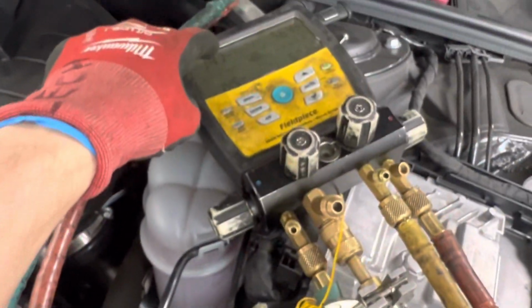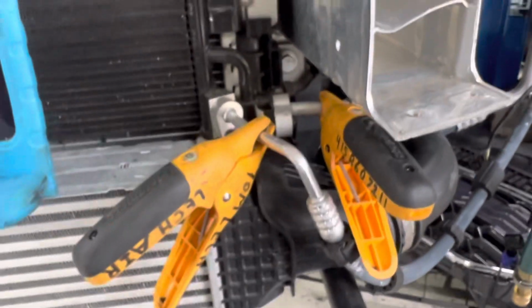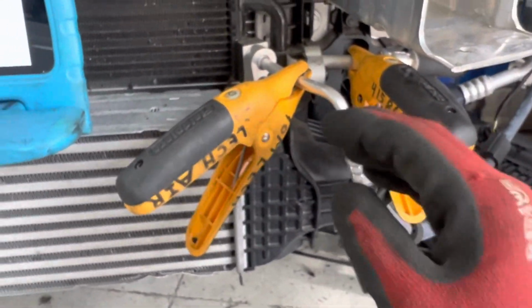And if we come up here, it's not correlating because this pressure is dropping faster than this can actually cool. And because this is such a small piece of metal, and out here it's about 58 degrees, 61 degrees, something like that, some heat is being input from the ambient close to my sensors, so it doesn't quite match. Now, our liquid has just disappeared in these lines.